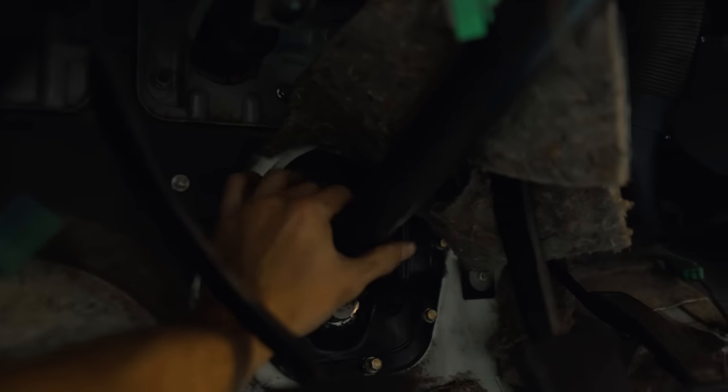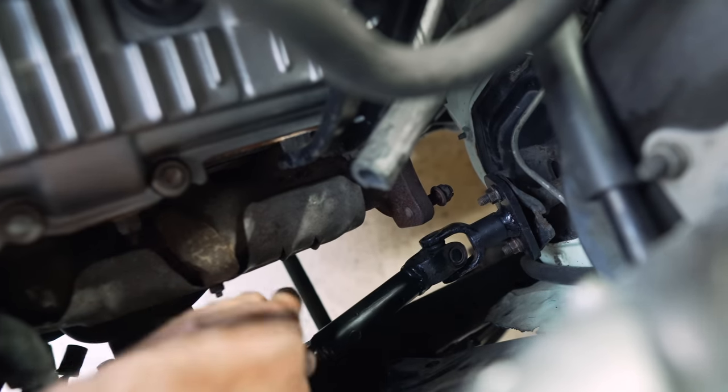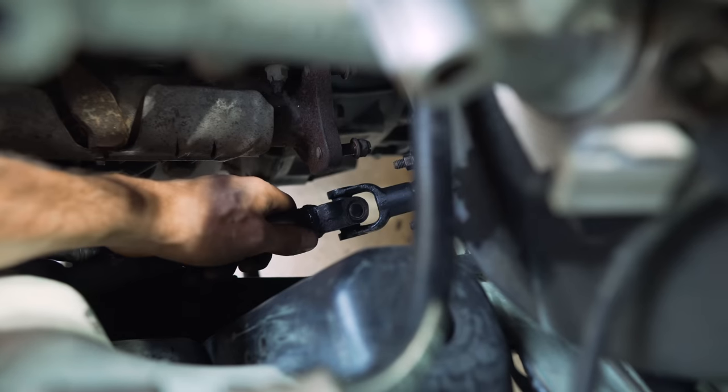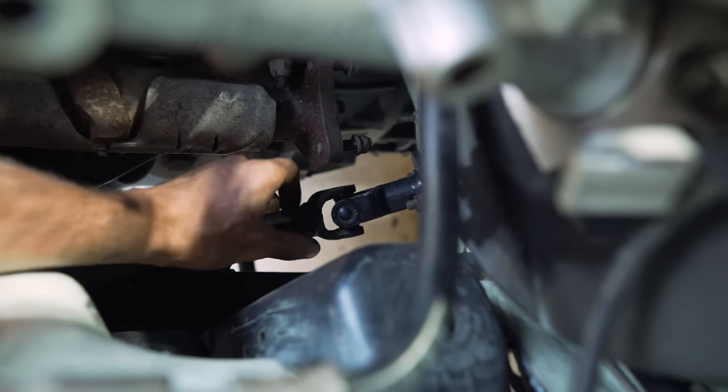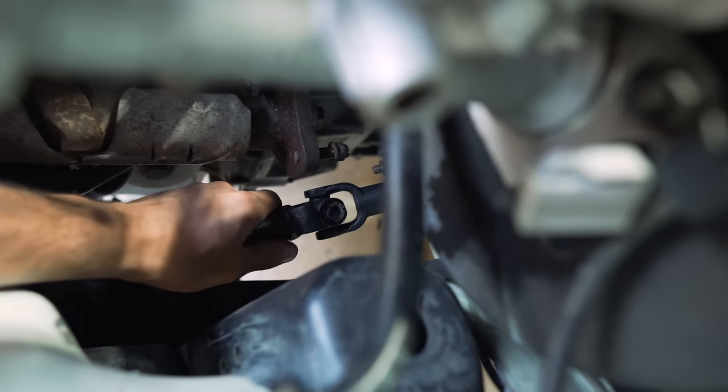To get that we're going to have to do some interesting stuff. We're going to start by trying to just make all of these holes a little bit bigger where it bolts to the firewall — make these just like an eighth bigger and then get bigger washers and then we'll try that. Making the holes bigger so we could pull it over to the driver's side a little bit. Now we have a decent amount of clearance — it's kind of hard to see on this lens, but now we have well over half an inch of clearance. It's a tiny bit tight there, but that's honestly the best we're going to get.